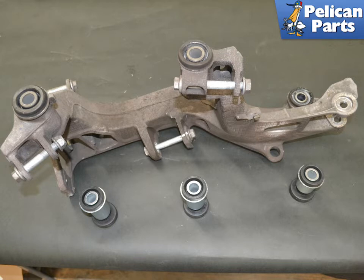Due to the design of the subframe, you cannot press out the bushings. You can remove them with a threaded rod and socket system, but first you must cut and grind the metal collar off of the bushing to get a socket to seat. Due to the cost of the subframe, we took ours to a race shop that made quick work of them. We still ended up saving a lot of money, as most of the cost of this job is in the labor, and removing and reinstalling the components and subframe itself saved us a lot of money.